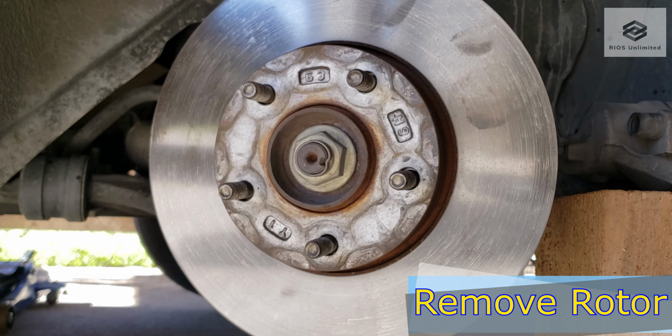For the brake pad that goes towards the back, you do need to apply some pressure so that the metal contact goes inside the piston. Try to start with one side and work your way through the others. Just apply even pressure.